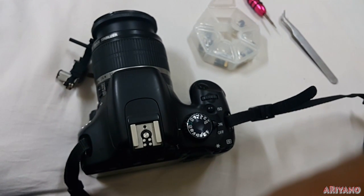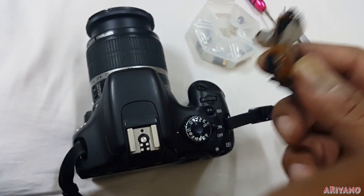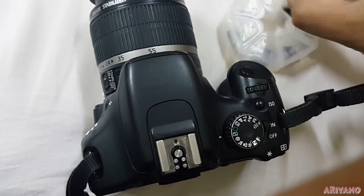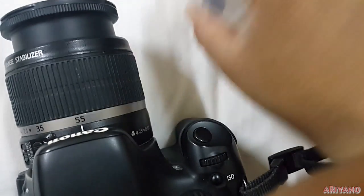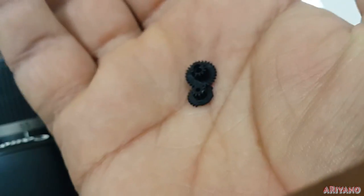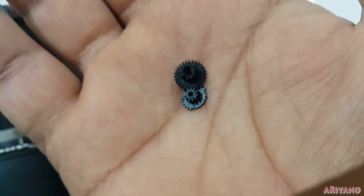The teeth on the gears are gone, so you just open it up, check the gears, and replace them. If you get lucky, get a complete housing and get everything done. Let me just show you the gears that I had which were stripped. These are the two gears that were stripped on my camera — all stripped out. That's about it. Hope this tutorial is helpful to people.